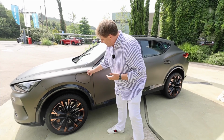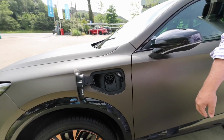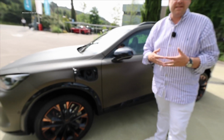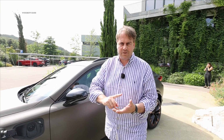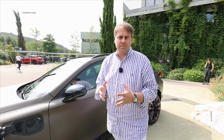Yes, it can be charged up here at the front with Type 2, meaning AC power, now 3-phase 11 kilowatt. They've noticed your critiques on our channel and of course said that in electromobility, a plug-in hybrid must also be able to charge quickly. If we now transfer this to 25.8 kilowatt hours gross, 19.7 kilowatt hours net battery pack, 400 volt technology, then we can manage to go from empty to full in 2.5 hours, and that's basically just a shopping trip, right? That's okay, yes.